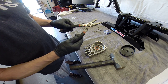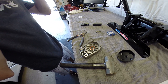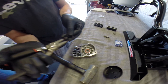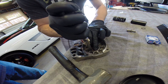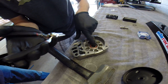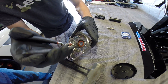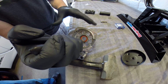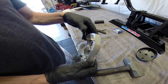Now take your snap ring pliers and install your snap ring — safety glasses, safety first, you don't want your ring to snap back and nail you. There's a little groove in there where the snap ring is going to seat into. Press it down and it locks it in place. To double check, switch the pliers and press it out — you can see it moved and fully locked in place. That is 100% what you want — you don't want that snap ring coming loose.